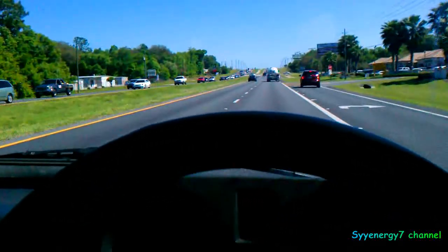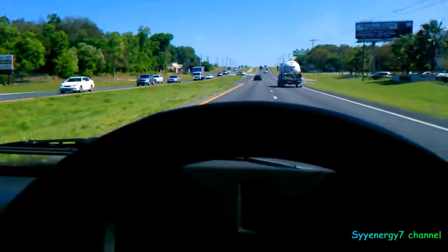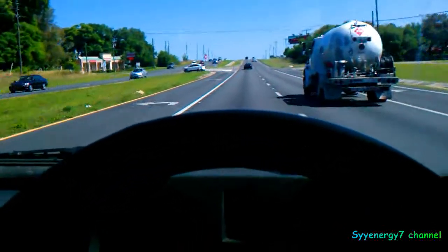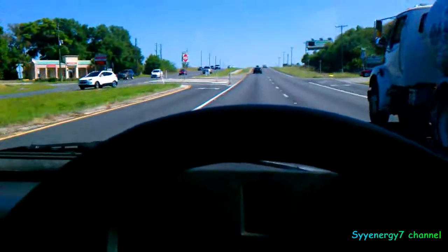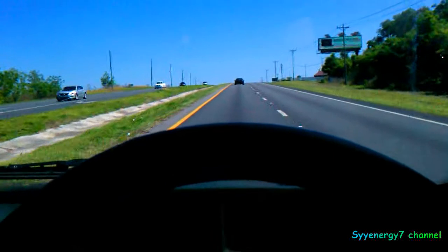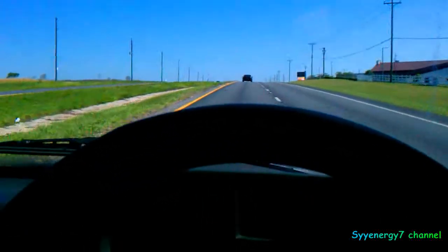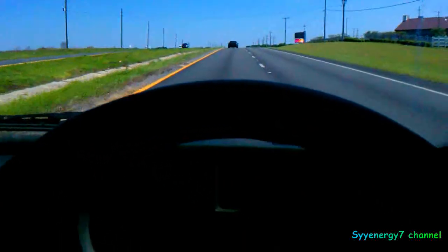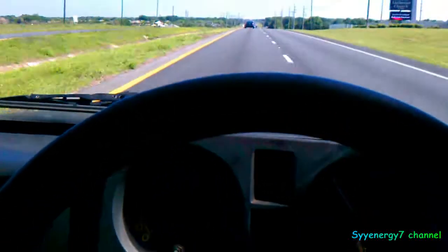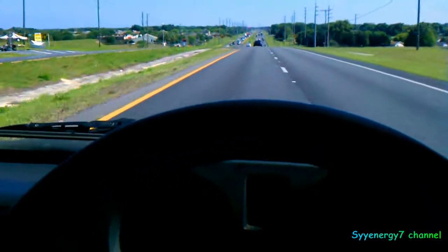The only thing that's screwy with this car is wind. That's where you get blown around — you're doing about 55, and if you're doing about 60 and the wind kicks up, you're in a Samurai. Scary drive, man, even with the stabilizer up front. I might change the caster angle, put some shims up under the springs. But I'm not sure because it's not really that bad. I'm running stock stuff. I don't have any problem with the thing moving around with the locker.